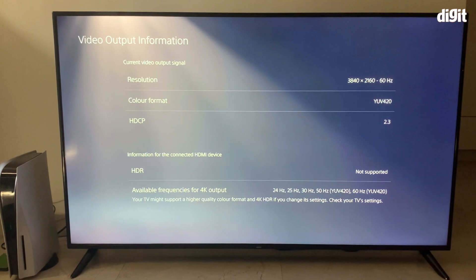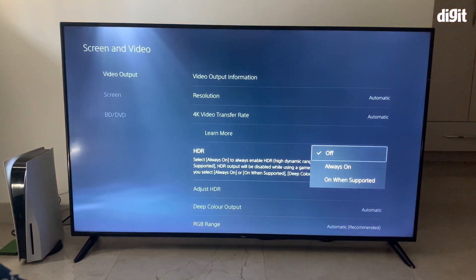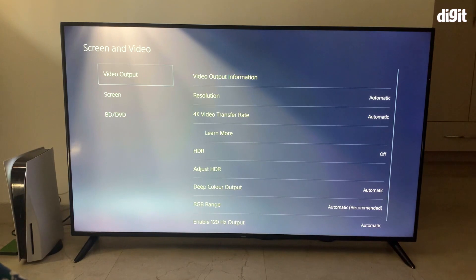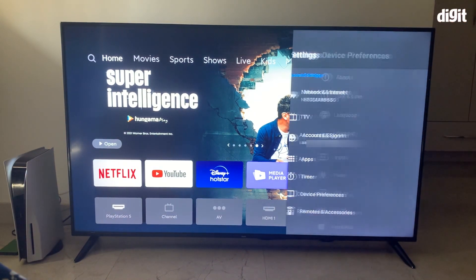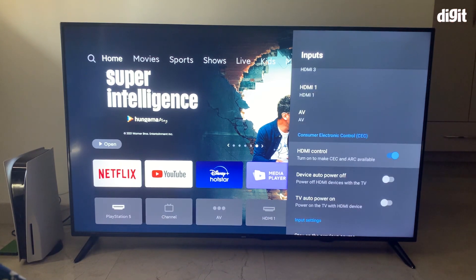What you need to do is press the center button on the remote control of the Redmi TV, but pressing that actually lets you control the TV and does not bring up the settings of the TV itself — it lets you control the settings of the PS5, as we showed you with the remote control. So you actually need to go back into the settings of the TV itself and change HDMI CEC. This will disable your ability to control the PS5 using the TV's remote control.